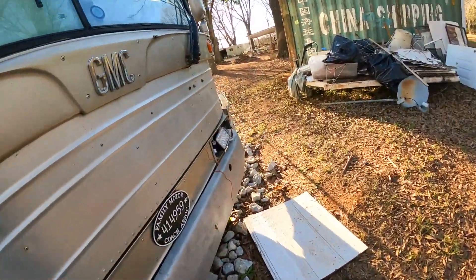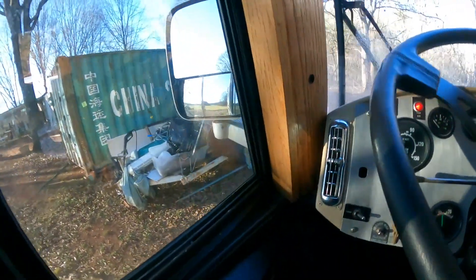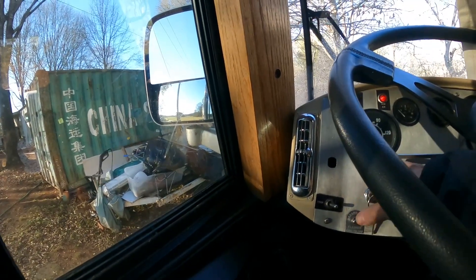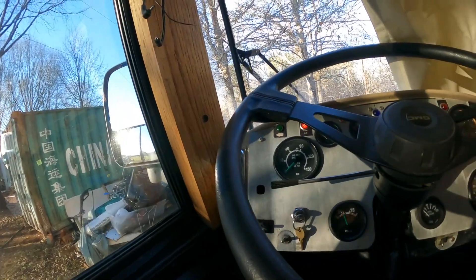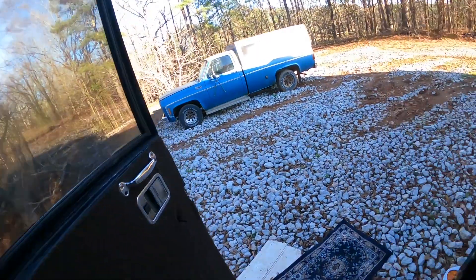The headlight worked. And it doesn't work — probably because I might not have a high beam. No, I have the high beam on. Why is that not working? That should be working. Let's find out what happens here. Dimmer switch on, everything's on. I don't know why it's not working. We've got lots of voltage — you can see the 26.5, 26.6. Let's go back out and see what happens now. Maybe they're on. If not, I've got to do a little bit more research to find out why they're not on.